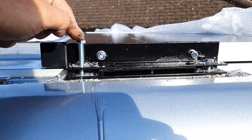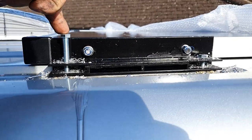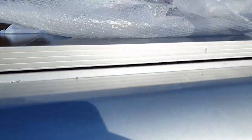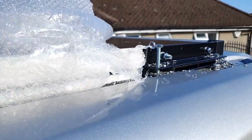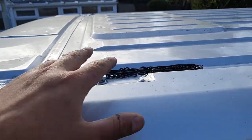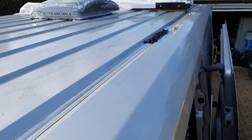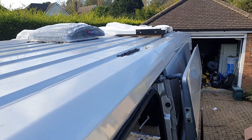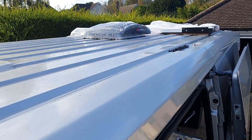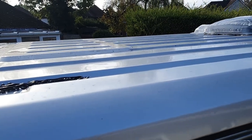So we've gone through and drilled through the brackets into the roof. We've put our spacer in place first to stop any compression between these two parts. Once we've drilled the holes, we've then popped a bolt in each hole to hold it in place and keep the whole panel system square, whilst we move on to the next one and drill the next one. We've cleaned it all up, got the mastic on there, got all the filings off, and yeah, just ready to lift it in place now. We've had to cut down a couple of the bolts because they end up coming underneath one of the roof joists, so we've had to cut the two rearmost bolts down a bit — that's not an issue at all. Now it's just a case of lifting the panel on, getting it set nice on this mastic, and getting it bolted up.